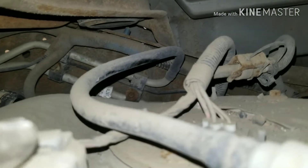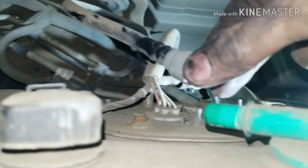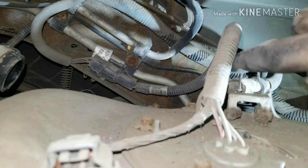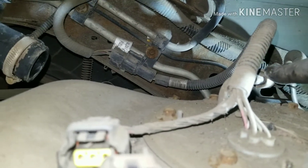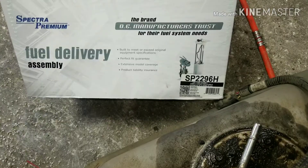Now that the tank is dropped down, you have access to your fuel filler neck and your fuel pump. For the connector here, squeeze these two together and it pops off. The screen hose here — press in the back and it pops out. For this connector on your line, take a screwdriver to the flat spot and pry it out. Next, take some WD-40 and spray it in here to loosen up any dirt, then take the connector off the frame rail. You'll need to use a quick disconnect hose tool to get the steel line off.